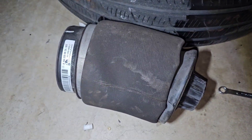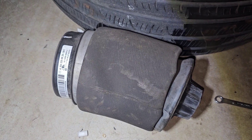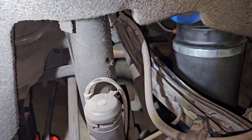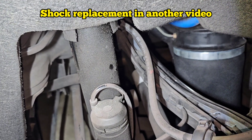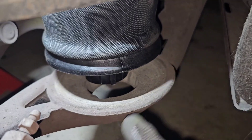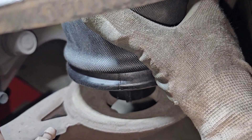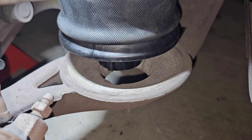It's tight and ready to put the wheels back. If this one has gone bad, I'm pretty sure the other one will go bad as well, so it's a very good idea to replace them in pairs — that's what I'm going to do. This vehicle has about 100,000 kilometers on the clock and the shock is leaking terribly, so before putting down the car I'm also going to replace the shocks. Before putting back, match up this slot with this plastic — you need to rotate it and match it up with that slot so it won't rotate in the future.